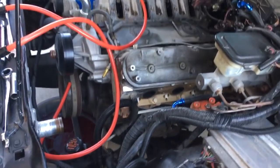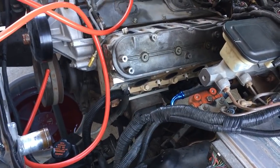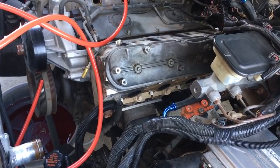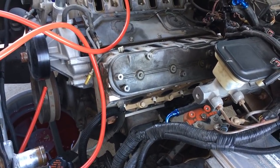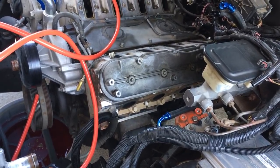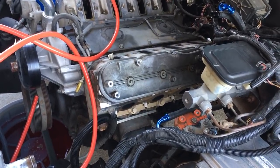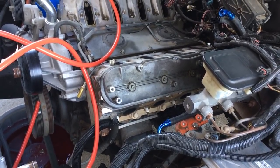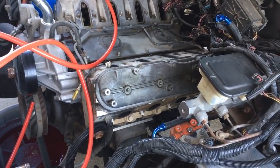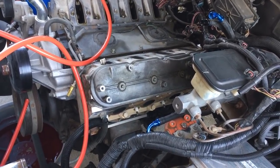because I realized the clamshells that I'm using have a 2 3/8 inch center. So from where it bolts to the adapter to the center of the bolt hole is 2 3/8 inches. Well, I can lower this engine down 5/8 of an inch by going to an engine mount that has a 1 3/4 center, from the flat mounting surface to the center of the motor mount bolt is 1 3/4 inches, which is going to lower my engine 5/8 of an inch.